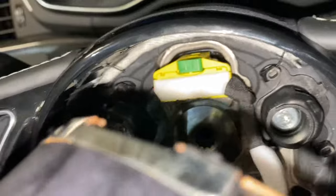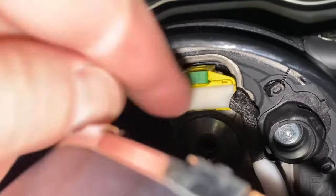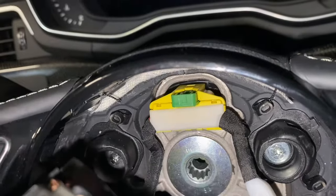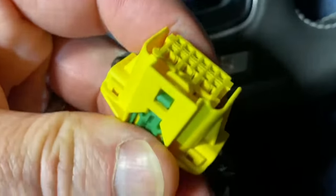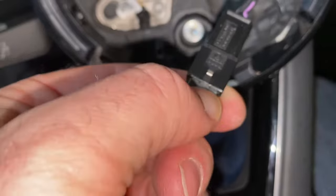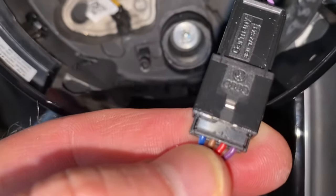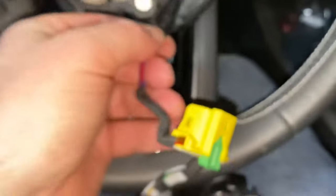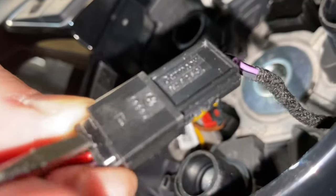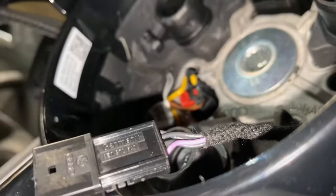Once you get the airbag popped loose, you're going to see this yellow clip in the back, and there is a green part right on top that needs to be pulled out towards you, like that. Then you're going to pinch the green part and the yellow part and pull the clip out — pulling up on here releases the little clicking mechanism. Removing this clip is fairly straightforward: get a small screwdriver or pick, get it right under that little plastic bit, be gentle but lift it up and it'll pop right out.